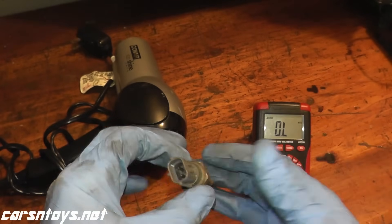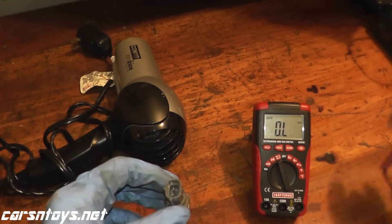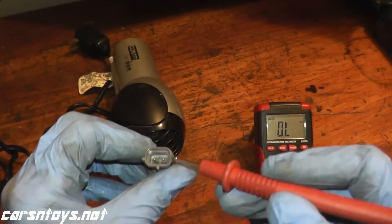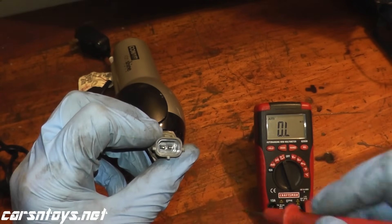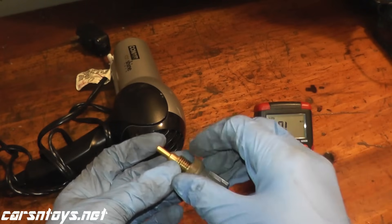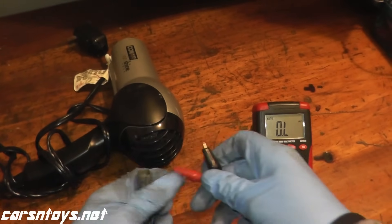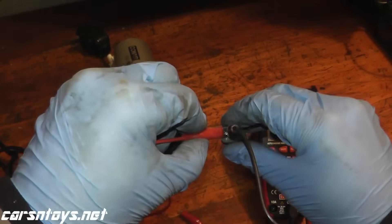You can quickly do a test, and the reason why this is important is because the sensor may be okay but maybe you have a wiring issue. With the multimeter you have two leads — a black and a red lead. It does not matter which lead touches the prongs. Place one lead on the left, another on the right. Then with this hairdryer, I'm going to heat up the end, and we should see the reading decrease as the hairdryer places more and more heat on the sensor. That's a very simple test you can do at home just to verify that the sensor is working correctly. I just like to use alligator clips — it makes the job a lot easier and frees up your hands.